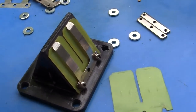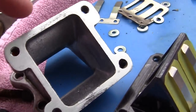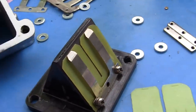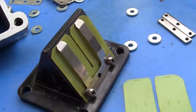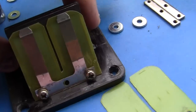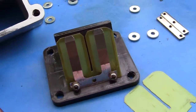If you have a CT intake like right here, the reeds have to flap open in a confined space. In order for them to flap open and closed at 10,000 RPM, 2,000, or 1,000 or whatever, they have to be aligned. And you can do that with your hands. This is not rocket science, my friends.